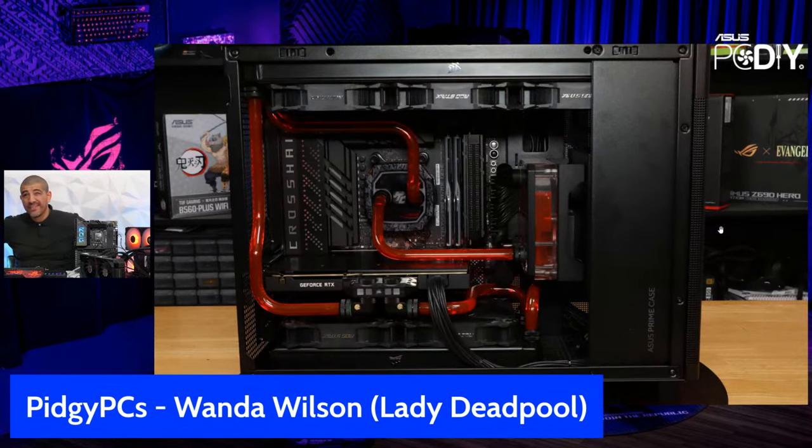It's a super easy chassis to work in, and it also has a huge amount of flexibility. You don't have any weird split chamber designs. You don't have any riser cables. Just a nice, big, clean, open space to work with. So you can go mini ITX, micro ATX for the motherboard. You can fit up to 360mm radiators. You can fit in pumps, distros, all kinds of stuff, as you can see, even though you've got a smaller chassis.